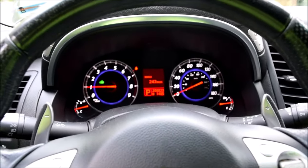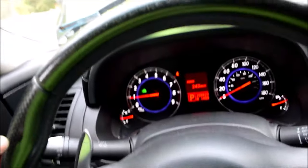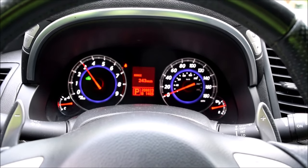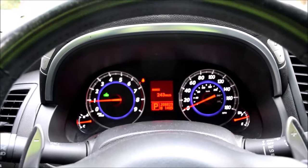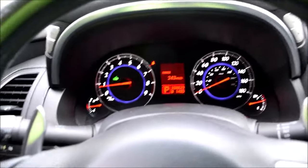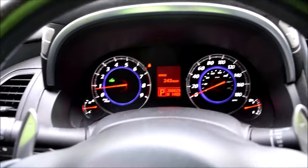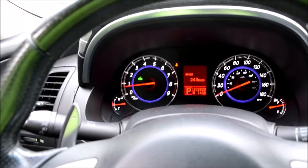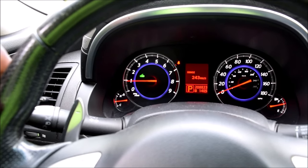No sloshing — I'll take that. Let's keep an eye on temperature. I'm going to rev it a few times; they usually say rev to about 3000 RPM, especially if it's right at temperature. You want it to get to temperature, you want the thermostat to open up so it's flowing through the radiator, and then rev it a few times. Did someone say 3000?